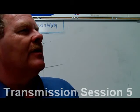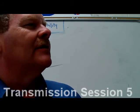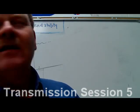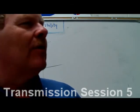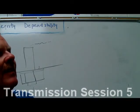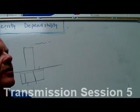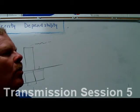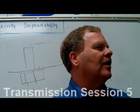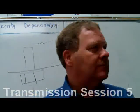There are electronic pressure control solenoids and hydraulic pressure taps on the 4R70W — you've got a direct clutch pressure tap, forward clutch pressure tap, electronic pressure control pressure tap, intermediate clutch pressure tap, and line pressure tap. That's five different pressure taps you can use. There's also a solenoid connector gauge, which is a go-no-go gauge used to determine if the solenoid connections on the lead frame have opened. This is for the 4R70W transmission.